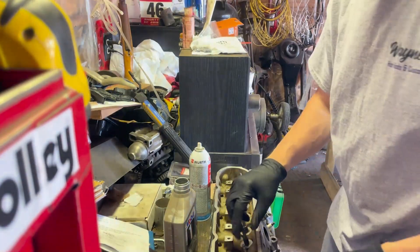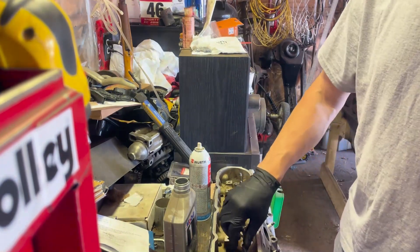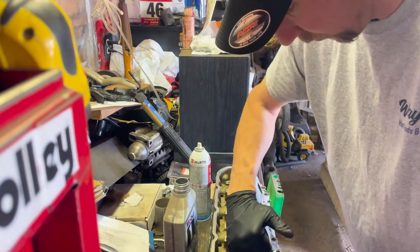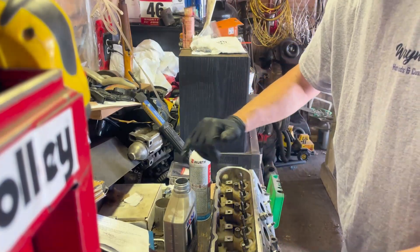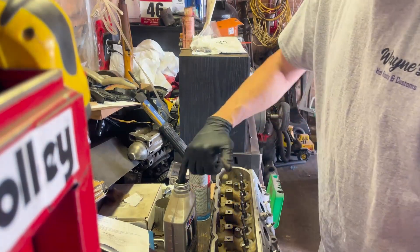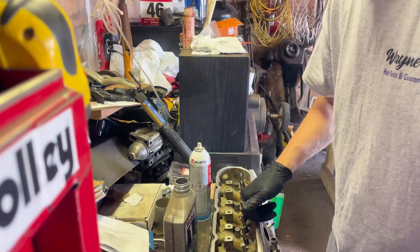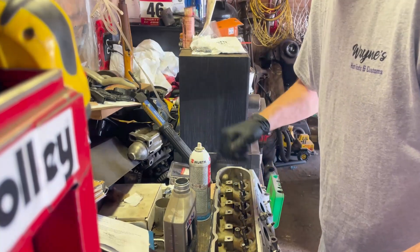The head is down, the valves are all in now. A little white grease on the shaft just so we don't have a dry startup. I'm going to take a little tiny bit of oil and put it around the base. This is obviously an aluminum cylinder head. These are your steel spring locators that are going to go in each spot. Obviously when the motor runs there'll be oil all through here, but during startup I don't want anything bad — no chances for failure.